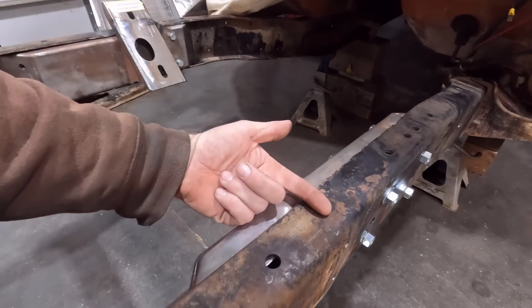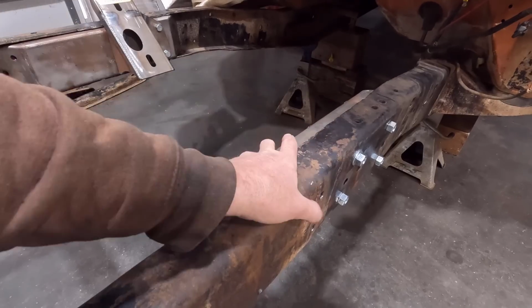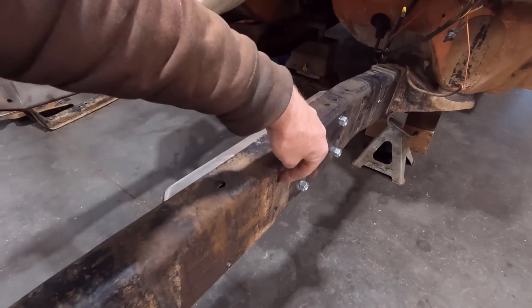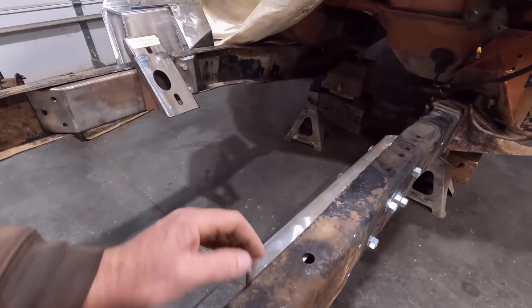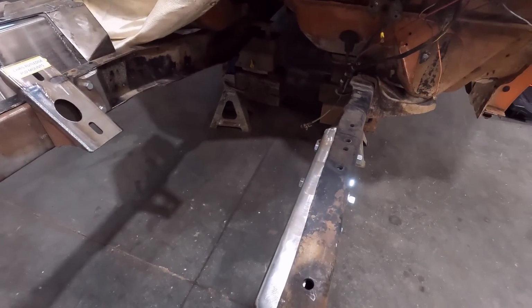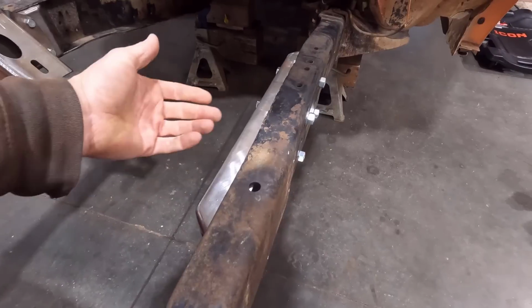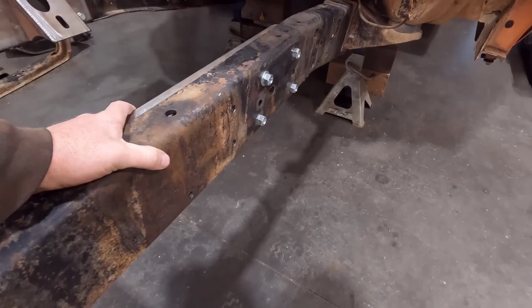And the bushings that are welded in this thing are going to stick through the frame that the steering gear is going to mount to, and I'll weld the outside of it. So the steering gear is going to have a nice flat area to bolt to. And it helps hold this thing in place, so it's actually going to go in a ½ inch. I hope I described that. It's really neat because you're spacing it out and you're using these holes in this as a template, so it's perfect every time.